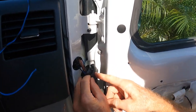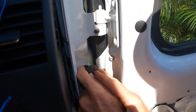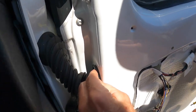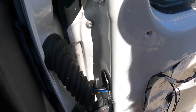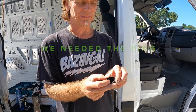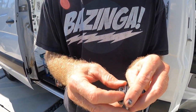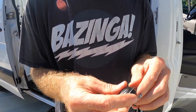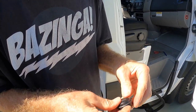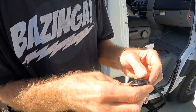After fighting, trying to get this boot back on the grommet, I realized that by sticking my hand under the dash I could just take the grommet off, put it on the boot, and then it'll pop right back in place. So if you're fighting with the grommet, just pop the grommet out to fit it on the boot. When you order these speakers, they come with a surface mount adapter and this little ring adapter which the tweeter pushes into. It should fit into the factory location. Once you snap this together it's a pretty tight compression fit, so you just have to work it a little bit. And there we go — snapped into place and ready to go into the dash.